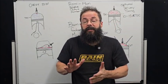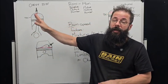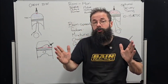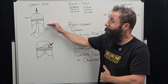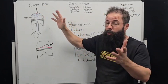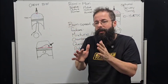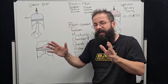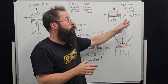The first thing we need to understand is burn speed and timing before top dead center. Using a small block Chevy as an example, 32 to 35 degrees before TDC is when we're firing the plug. We have a burn speed duration of around 40 to 50 degrees. Most small blocks on pump fuel, if the compression and cam are right, end up around 34 to 35 degrees — though it really depends on the cylinder head. Say 34 degrees. From there, we have to deliver the timing — the pressure front.